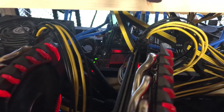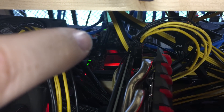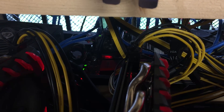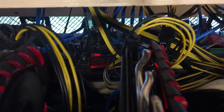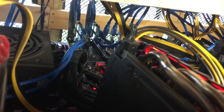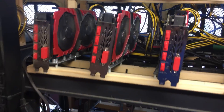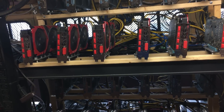Here you can see the power switch right over there — there are these little wires. Each rig has 12 GPUs, and over there in the corner there's a port multiplier. That allows you, on certain motherboards like this one, to increase your GPU density. Occasionally there's a minor issue getting it to detect and you just swap a port.